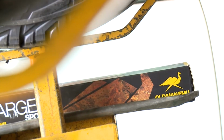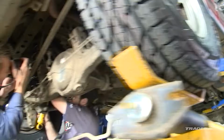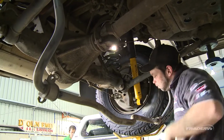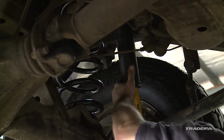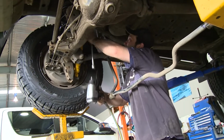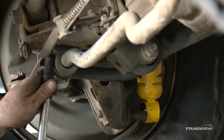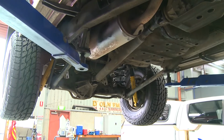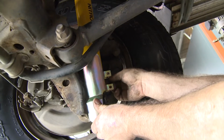Commonly known as shock absorbers, they're more accurately termed a damper, as it's the springs that absorb the energy created by bumps on the road. The dampers stop the spring from continuing to oscillate. This is why it's critical to have a properly matched system. ARB says the OME Nitrocharger Sport shock absorbers are the most finely tuned shock absorbers on the market, with all valving work carried out in Australia by OME's ride control engineers.